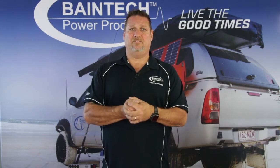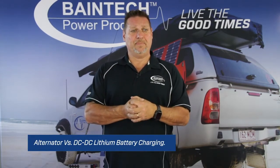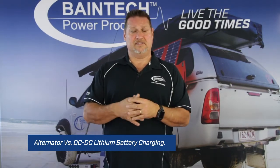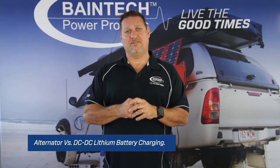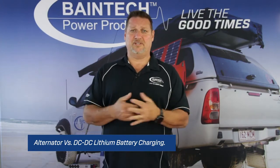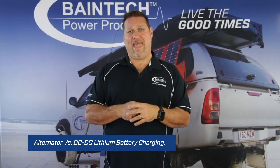So yes, you can charge a lithium battery from an alternator, but we definitely don't recommend it. There's a lot of evidence out there to suggest not to do it, and even the guys selling these beefed up 200 amp alternators for 200 series Cruisers and the like. Yeah, great to get 200 amps into your 200 amp battery, but you don't need to charge a battery in an hour, because that's going to be heating up unnecessarily. You put stress onto that alternator for an hour, but it doesn't need to be.